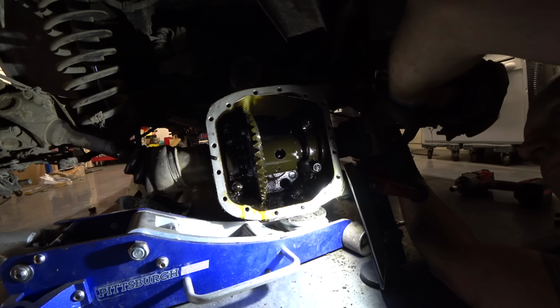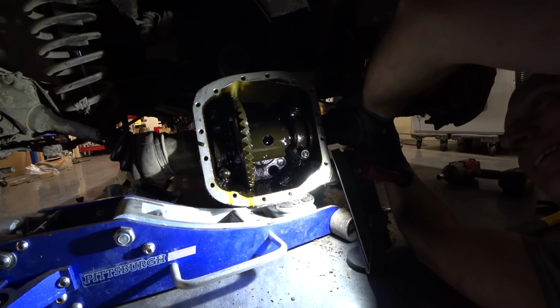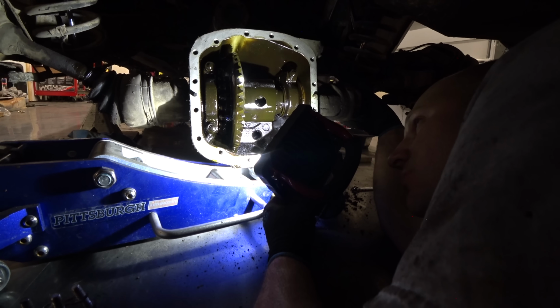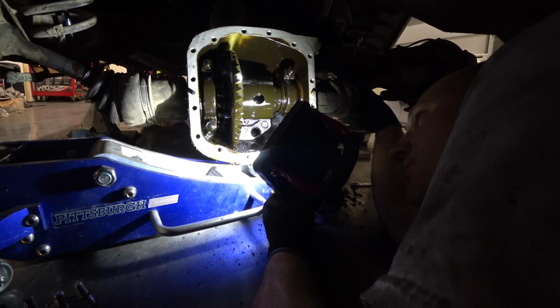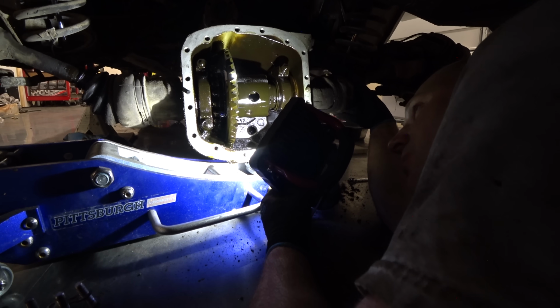What a nightmare. Wire feed. Put all the wire in it. There's that. You gotta start at the back, though. You can't hit anything else. I don't honestly have another suggestion, except just spray it out heavily with brake clean and send it. Over and over and over again. And let it dry overnight, so it's not going to contaminate the welds too bad.